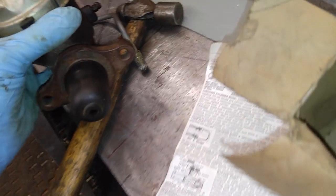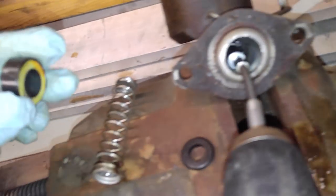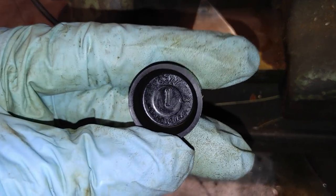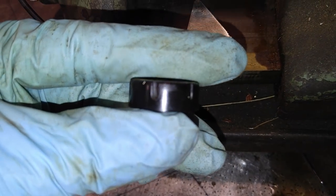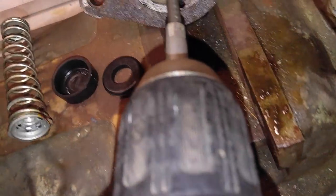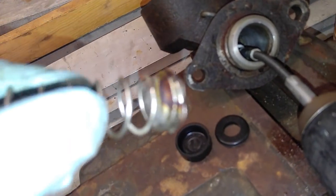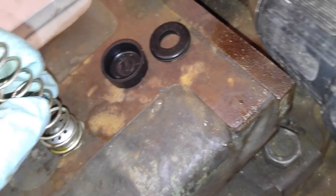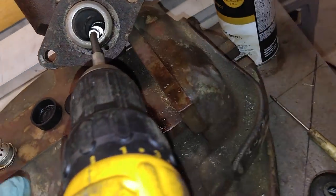Maybe I'll take it apart and look inside. The guys on the Corvair Forum are going to kill me — I'm going to try and rebuild it with the old seals, because they look perfect and I've done this before. Taking your life in your hands. These cups look perfect, made in the USA. I cleaned everything thoroughly with this — someone told me it's petroleum-based kerosene cleaner — but I'll flush some brake fluid through it.